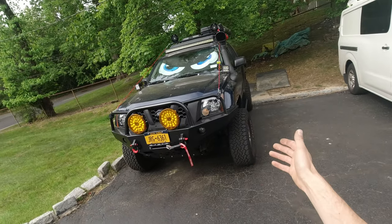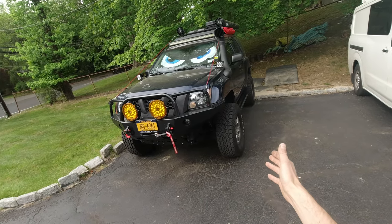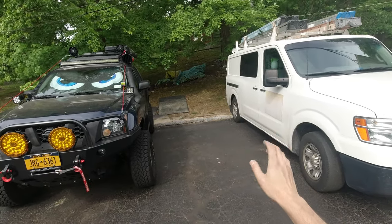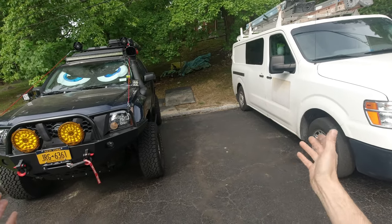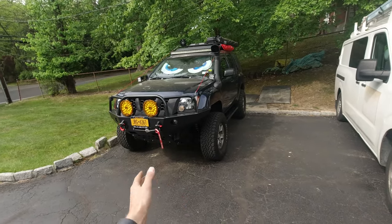All right, guys, the test is complete. The air compressor works great. It filled up my tire, no problem. Took about 2 minutes to fill it up from 10 psi to 35 psi. And the work van, from a nearly flat tire, it got filled up to 80 psi, no problem. Took about 4.5 minutes, but it got filled up. That's the important part. The air pressure switch works on it great. It shuts off. The tire gauge works as well.